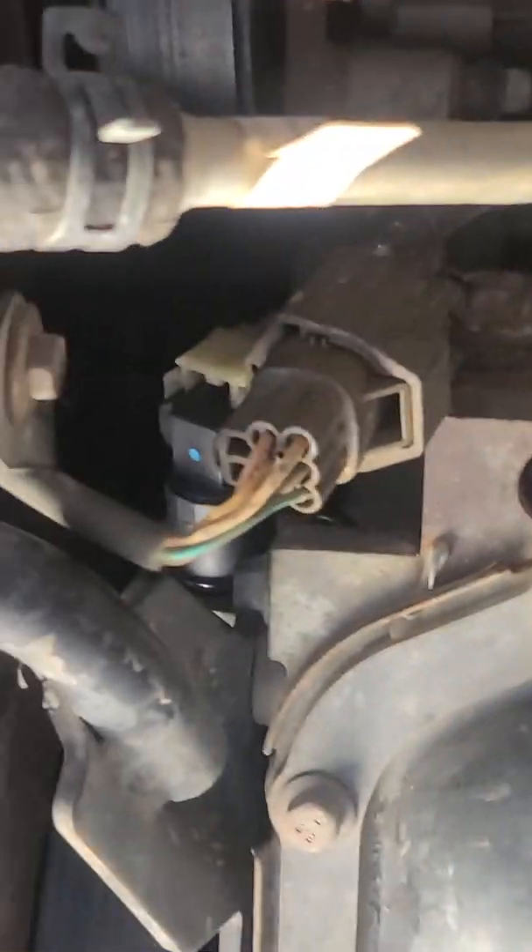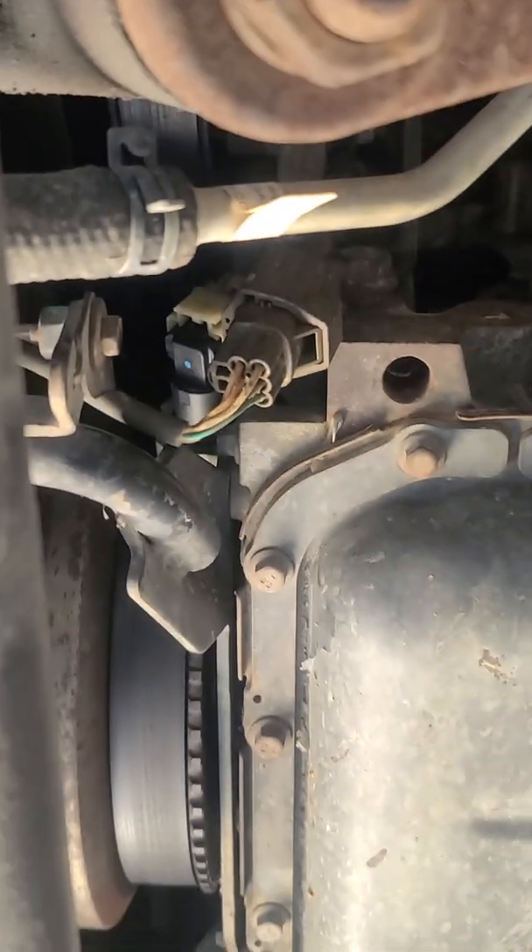They say it's a 5mm — that's what I heard on YouTube — but I was able to make it work with a 5/32 Allen and it worked fine. Just put it on a little extension with a quarter-inch drive. You're gonna be rubbing this line right here, so try to do it when the engine's cool because I was burning my hand on the block and on this line.